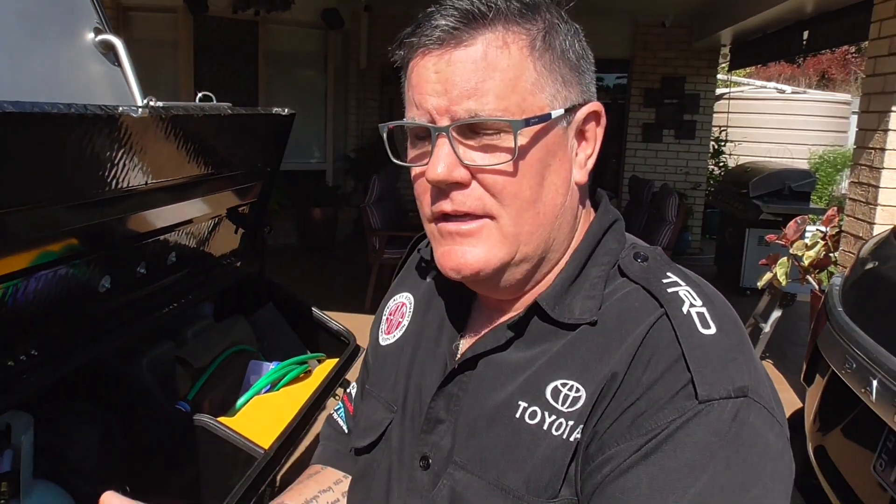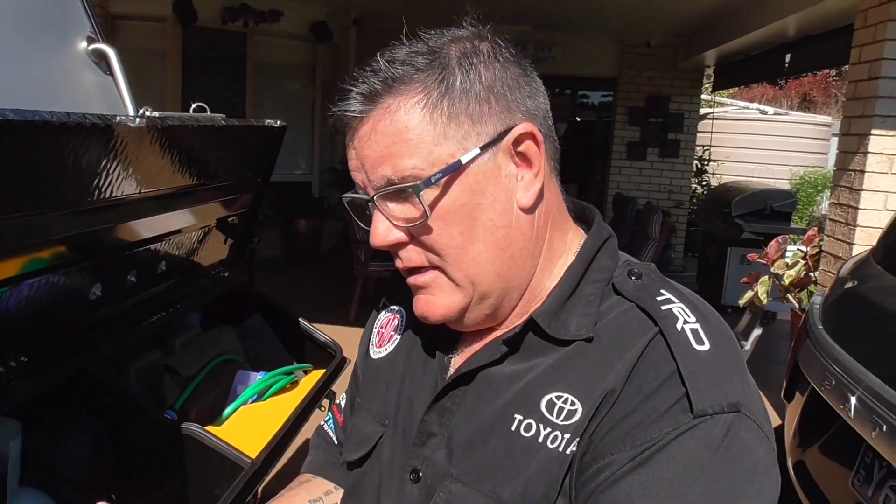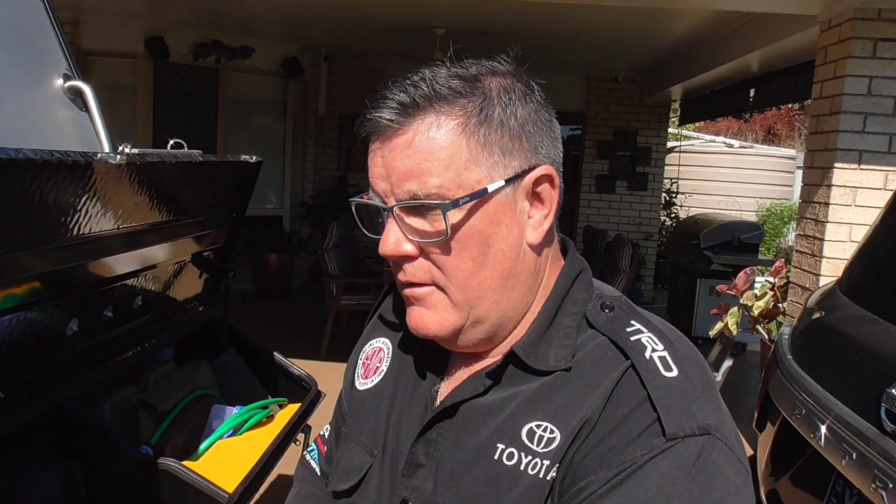...no gas — make sure your gas connection is flowing through. No water — if you don't have either the mains water hooked up or at least a water pump to put water into the tank, you'll get a fault light. The exhaust vent cover — if it's on, that'll give a fault light. And the last one is sometimes when it's really windy, it can blow out the pilot light and throw up a fault after a few times, or it could keep reigniting.